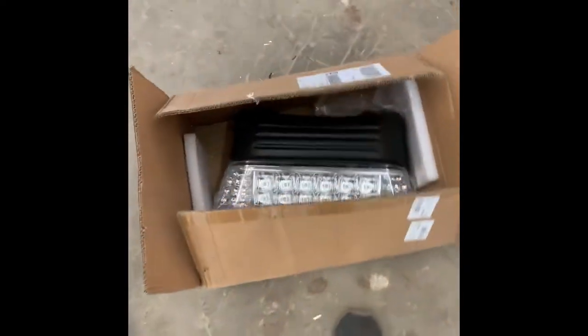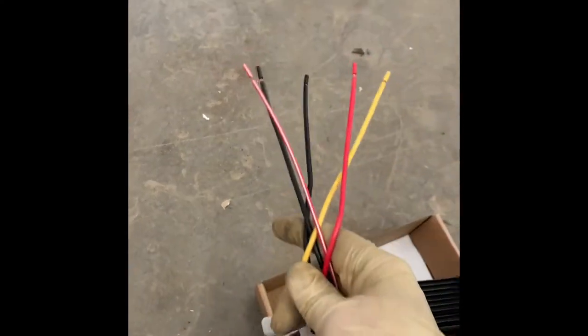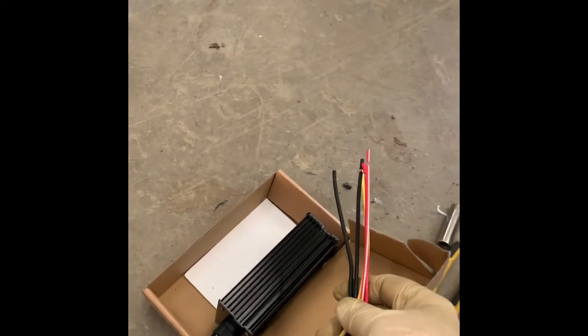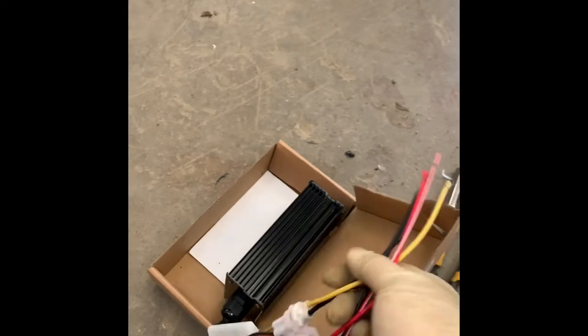Both tail lights are in. Now we're moving to the front to get the voltage reducer mounted and the headlight bar installed. On the voltage reducer, I have to unplug these two wires — the reason is that if you were going to use this voltage reducer on a different cart, you would use those wires to wire it up, since it wouldn't be able to plug into a bucket harness. Now I've got them unplugged. I'm going to mount the voltage reducer by running a self-tapping screw into that plate in the wheel well — one on top and one on the bottom to secure it — then plug the wires into the harness.